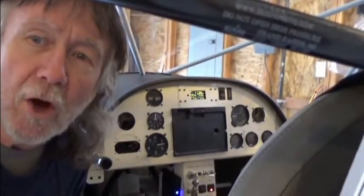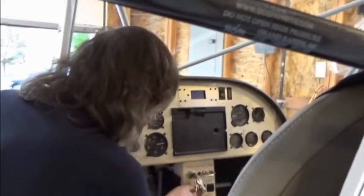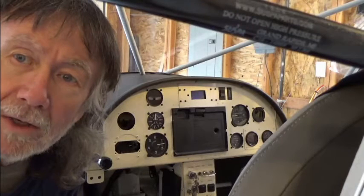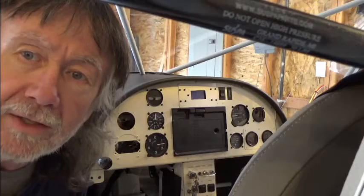Okay, I've got 200 degrees. I'm going to shut it off now. We're going to leave it set for about four hours and check the coolant level. It was left at the half-filled mark and we'll see how much it draws into the system.